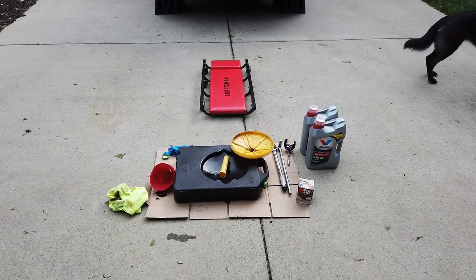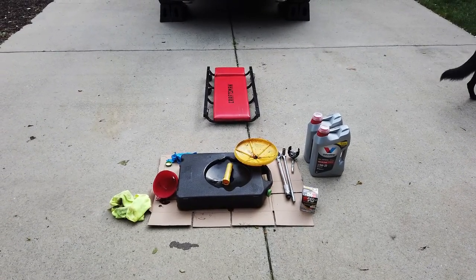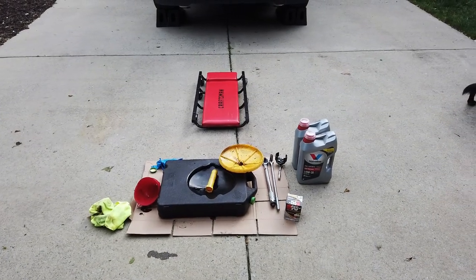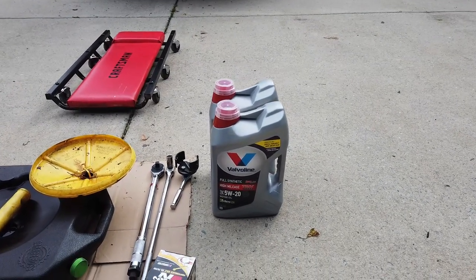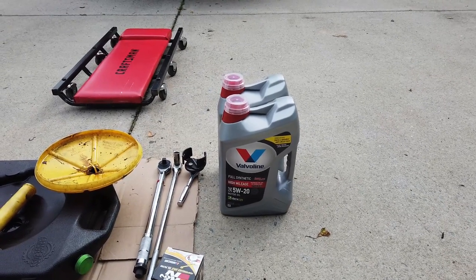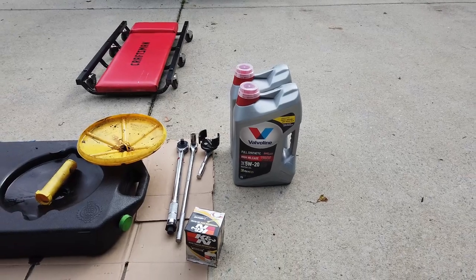Here's a quick overview of the tools we're going to need: a nice oil drain pan to keep your used oil in as it drains out of the Tahoe, and a funnel to add our new oil. Normally that's a 0W20 Dexos oil for your Chevy, but my friend Chris decided to go with 5W20 high mileage just to get the viscosity right for a high mileage vehicle.